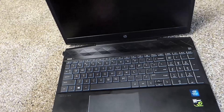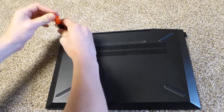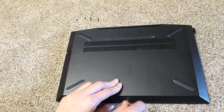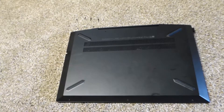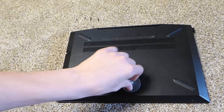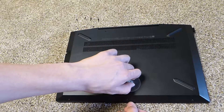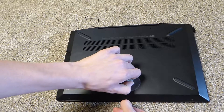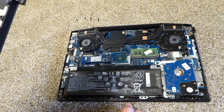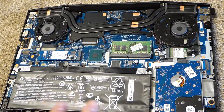Step number one, laptop is turned off. Step two, remove all the screws, then take the back off of the laptop. I recommend using a suction cup to get some separation. The first time is going to be a lot harder, so you might need a gift card or credit card to stick in here to pull up, but since I've done this multiple times before, simply putting my fingernail there was enough, and this backplate is kind of loose now.